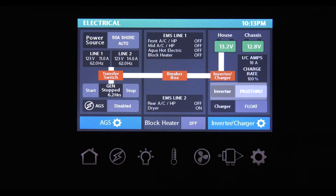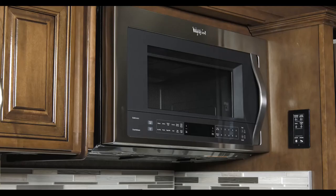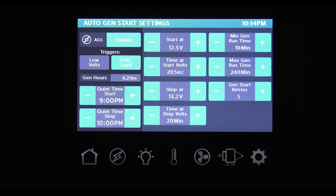For pass through, the inverter will kick out 110 volts when no generator or shore power is present — here you can use your TV, fridge, microwave, and certain outlets. These buttons start or stop your generator and this display shows how many hours you have on it. Pressing this button is how you set the triggers for your auto gen start. Hold down the disable button until this screen pops up, then hold enable for at least 3 seconds and release. You will see this screen with all your settings and options, such as your desired trigger and how many hours you have on your generator.